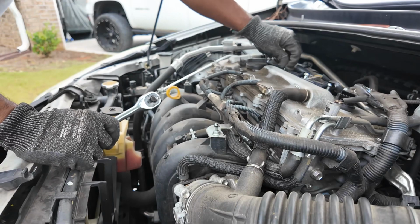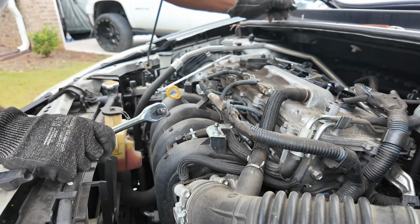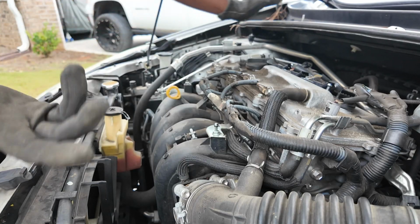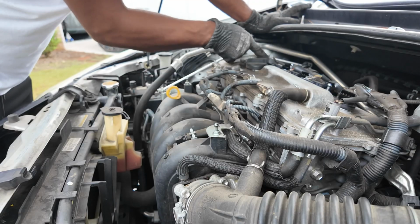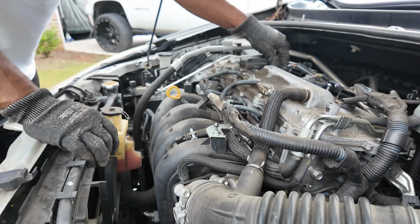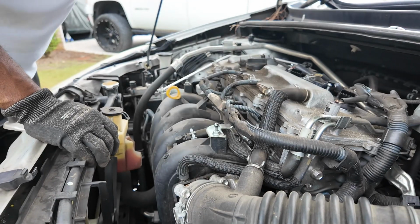Alright, so first we take all the screws out. So today I'm going to show you how to change spark plugs on a Toyota Corolla, pretty much, for all who are just joining the video. You take the screws out, unhook the plug, and then we're gonna take the coil pack out. So that's the coil pack. Alright.